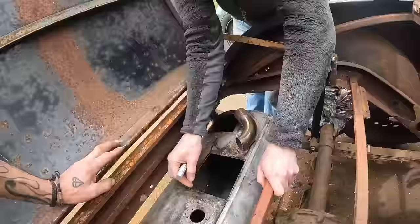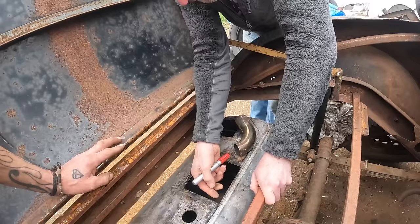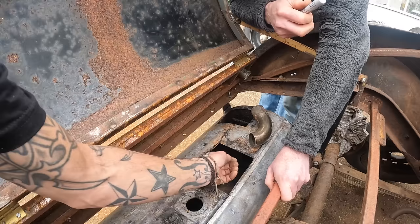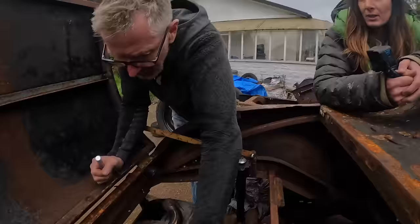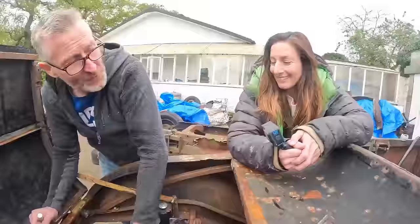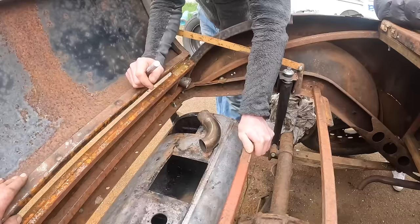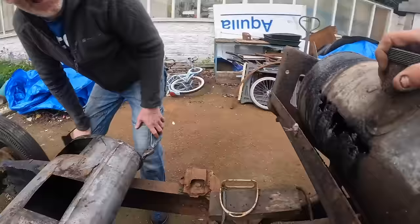This is Nat. What Chris is down for is he's kindly helping me out by sorting my tank out. This edge is fine, this edge is fine, this edge is quite close to this solder joint. I might weld a flange on underneath and just take along the seam here, fix that so I've got something decent to weld to along this edge. My consideration was to put a half inch flange all the way down with a tack, then weld the three together. If you can weld this, you can f***ing weld anything. Let's take it back to the Bracket Factory and see what magic can be worked. Just as a reassurance — when you want something done enough, I'm there waiting. So Chris is going to take Nat for a bit of a drive out on the rat.